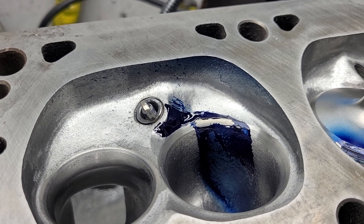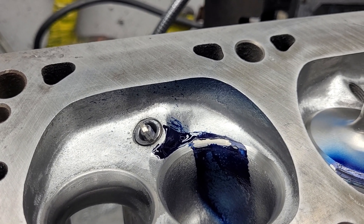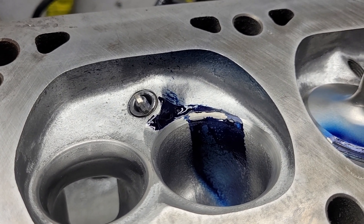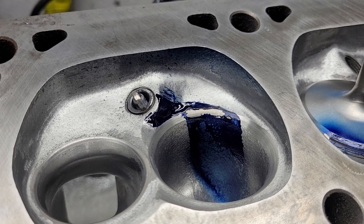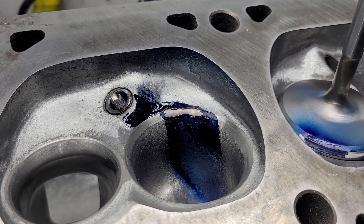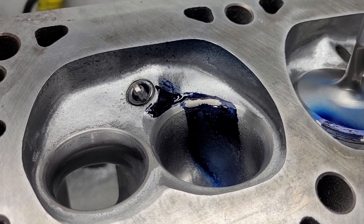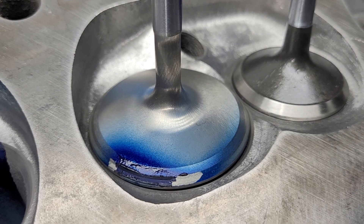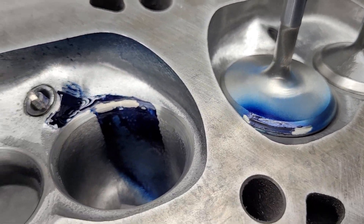This is a different application. The customer wants 400 horsepower, 360, 4400-pound truck, 28-inch tires, 3.55 gears, overdrive transmission. He wants to get it done with a smaller cam, so I'm going to need a back cut because I need the flow range to be high in the mid-range.